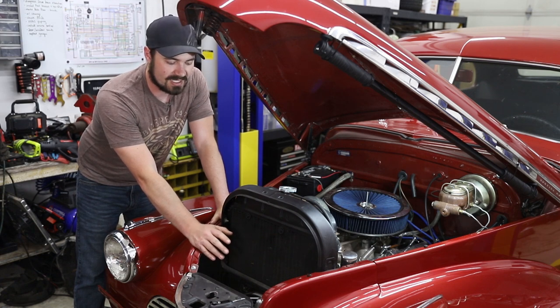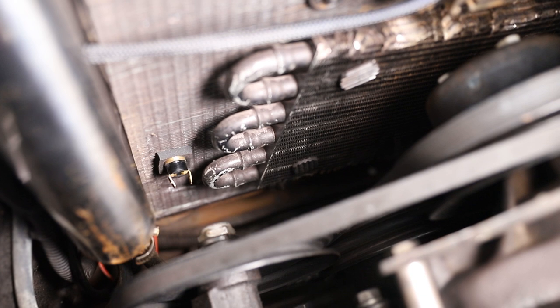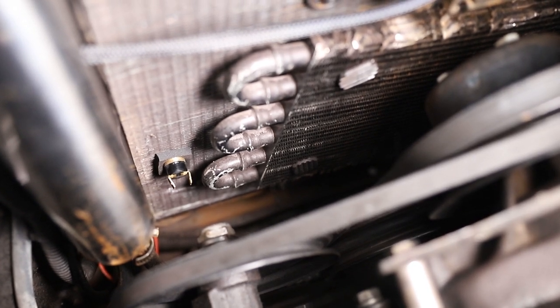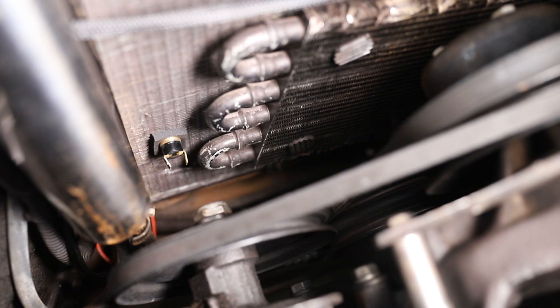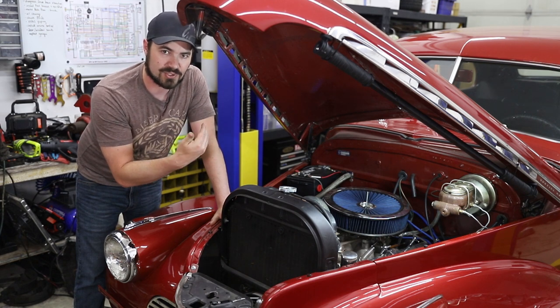But now that we know where this is and how it works, let's look at the blades on the back. The blades on the back are two prongs that simply carry some sort of current through. On one side for mine, all I need to do is attach a permanent ground, something grounded preferably back safely inside the cab to something that's a really good ground. Likely, it will be the same ground I'm carrying from the battery for the rest of the circuit. On the other portion, I will have the triggered ground that will be going to the other half of my relay. It will be connecting into the same wire that the toggle switch uses and will ground it out just like if I flip the switch.